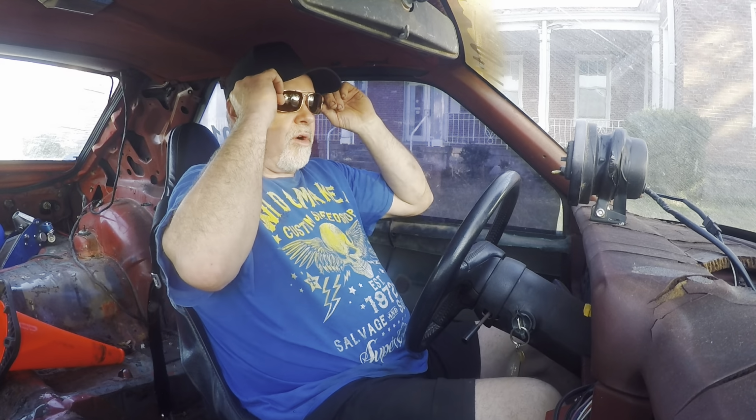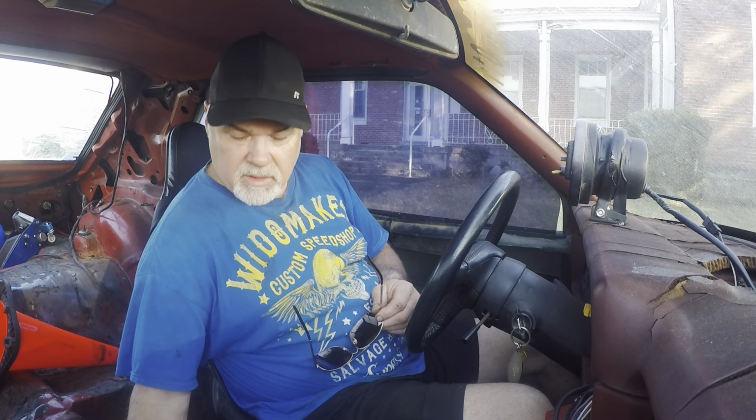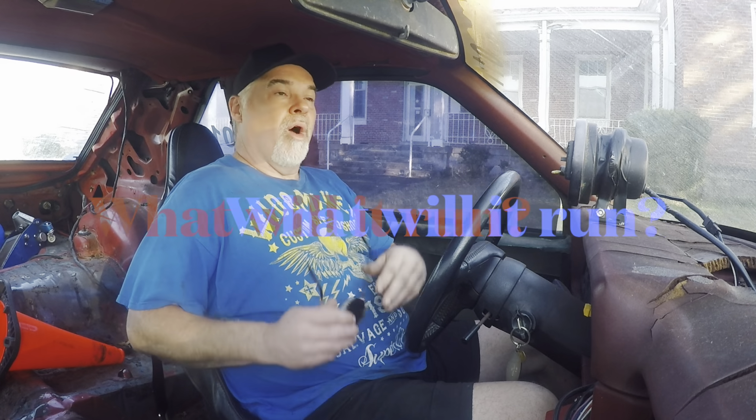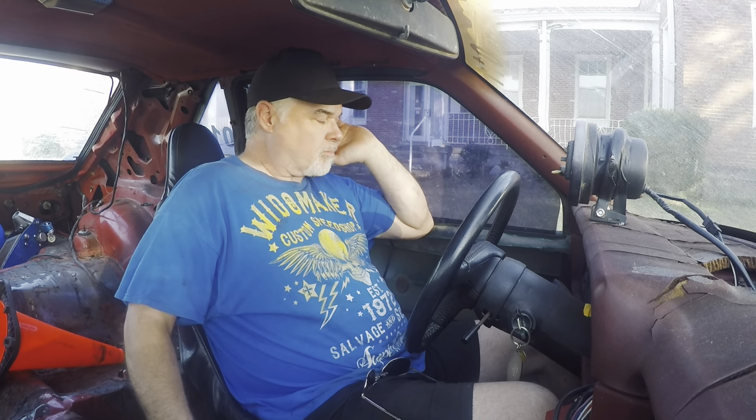We're gonna do our outro here in the car. So that's gonna do it. I hate to even say this again. You know, we can do the what will it run. You guys can speculate if you want. So hopefully, if we end up racing, we'll have changed to the Wolverine cam. We'll have put the electric water pump drive on, and then lost a couple pounds off the crank. And we'll have put the different front springs on, and we'll have put that one strut on.